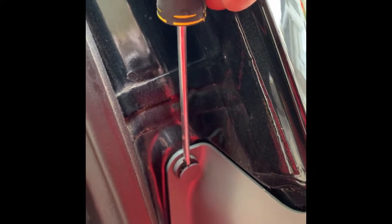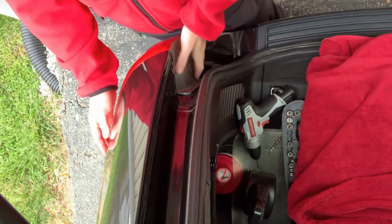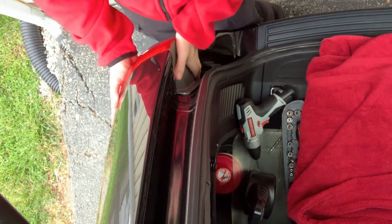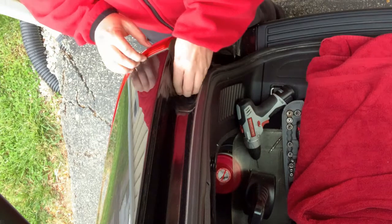Start with the rear. You've got these little plastic pullouts — always use a screwdriver or something flat to rotate it out like this. Sometimes they can be a little bit difficult to pull out, so use a little plier to pull that on out. That's the only thing that holds the outer side tail light in, so just give it a good tug and it will pull out.